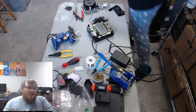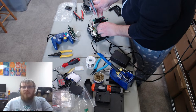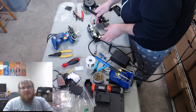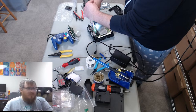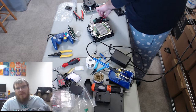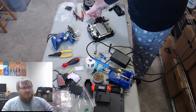Yeah, I'm wanting to do a power delivery GameCube power supply for USB-C. That'll just plug directly into the external port, so you don't have to do any internal changes to anything. Yeah, I already modeled up a connector for the GameCube power port, since there doesn't seem to be any third-party ones out there that you can buy. A power over Ethernet version? Huh. That would be fun.